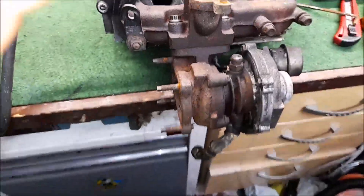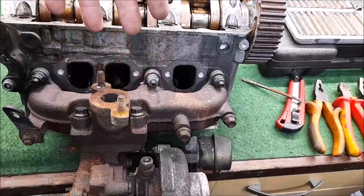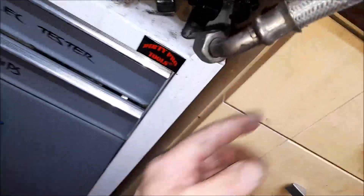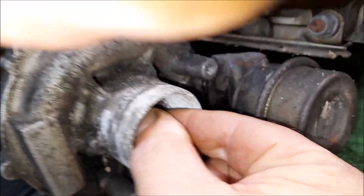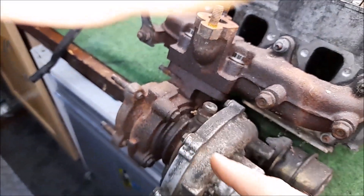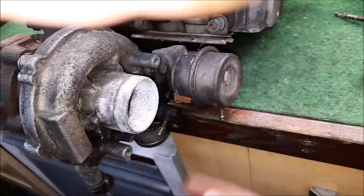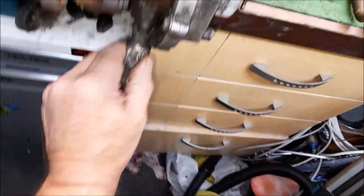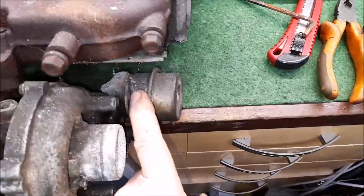Here it is on the bench. The turbo sits on the exhaust manifold - exhaust gases come out there. That's the inlet manifold letting the air mixture in, and this is the exhaust so hot gases go down to the exhaust pipe. They turn this turbine, and that shaft goes right through to this side. That shaft turns this impeller, which in turn forces more air into the engine to increase boost and power.